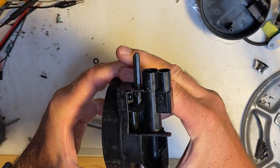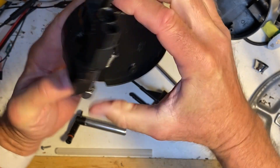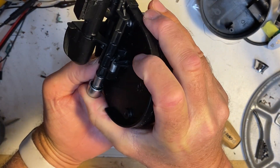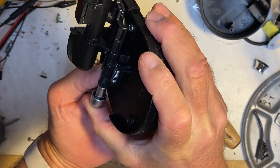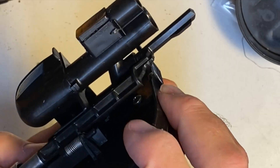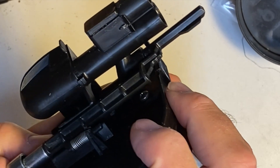This last piece is the cleaning button. You can see as you press the button, it pushes this rod and that pushes into the machine and hits a switch. That switch then drives steam out through the port. But since this is the cleaning cycle, you don't want it to pull milk out, so you have to break the suction. You can see here that when that gets pushed out, it opens up that path that comes up from the straw.